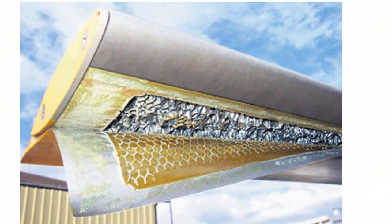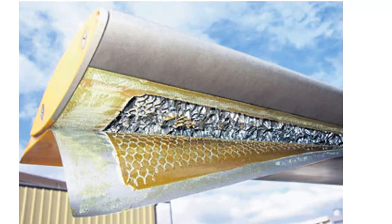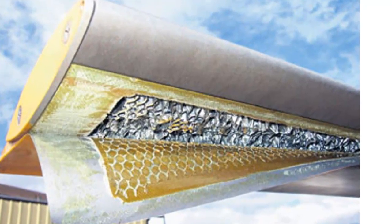Here's another way that built-up composite blades can fail: when the skin peels off. These things are glued and bonded together. There were a few R22 blades that had some voids in the bond and had problems because of that; most of that batch has by now been worked out of the fleet. But it's really important that these be inspected on a regular basis by a competent mechanic who knows what they're looking for.